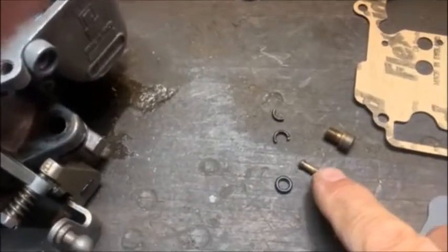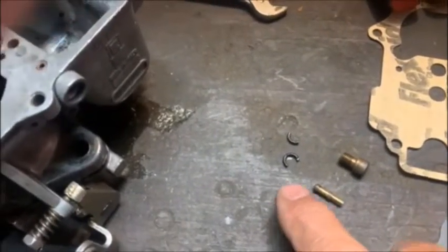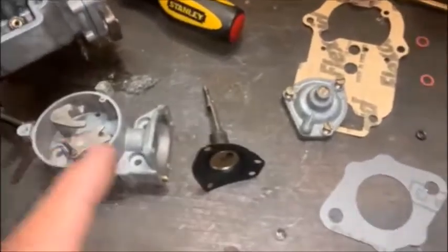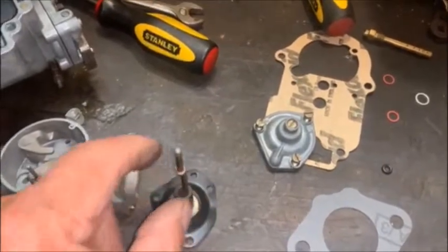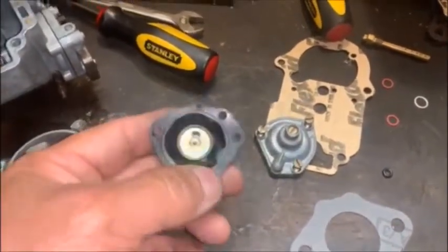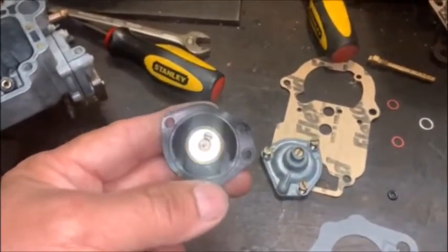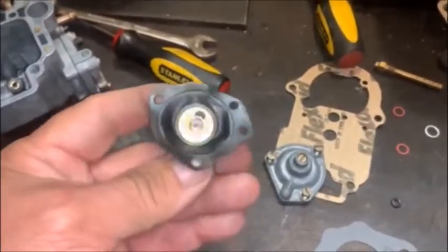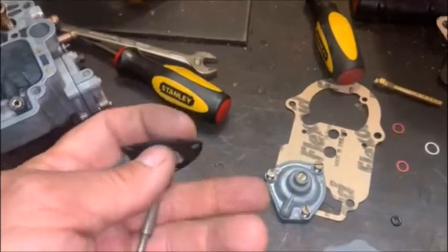I've cleaned up the idle jet, but the O-ring was so brittle when I took it off that it just broke. You do get a new one in the kit though, and it just goes in there. On the choke mechanism, this diaphragm is no longer available here - I believe you can get it in Europe, possibly as a loose diaphragm that you can re-pin. But here in South Africa you don't get it. It's not broken though, just a little hard, so I'm just going to put a bit of lubricant on it because it's dry and put it back and hope for the best.